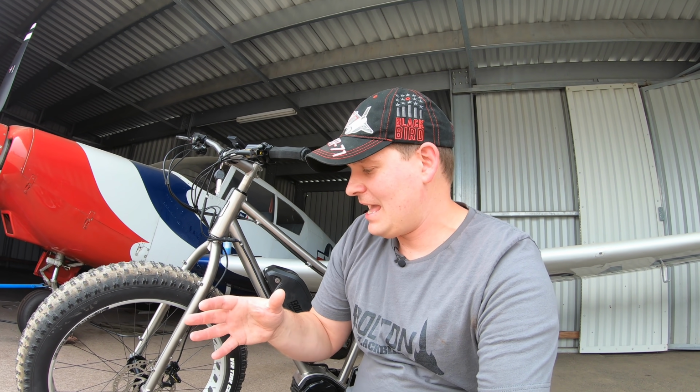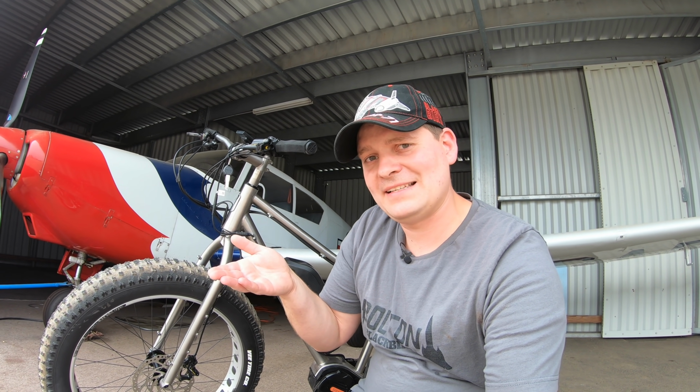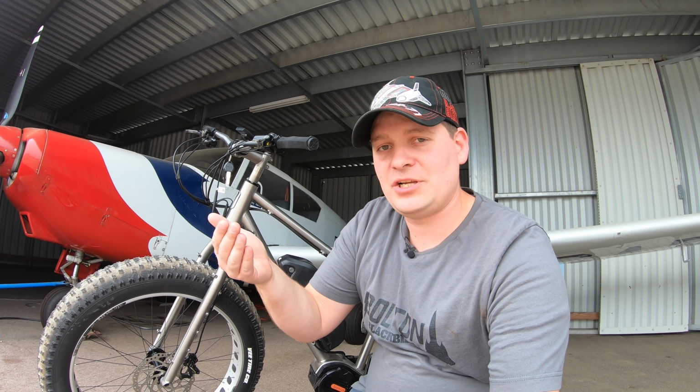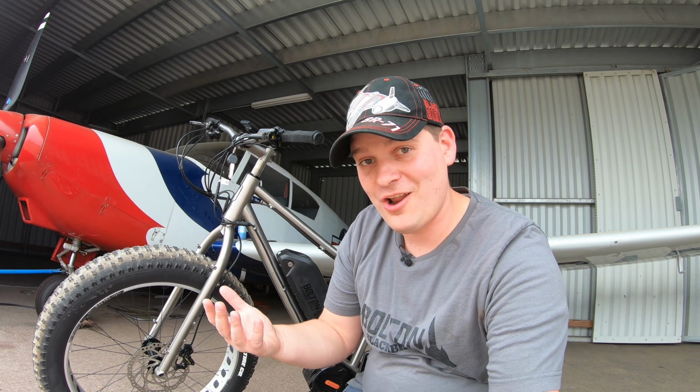And I do have some personal experience with this. Although I've never lost a wheel while riding, I did come close. I was on a mountain biking team ride, and at one of the stopping points, waiting for everybody to gather up, a fellow rider looked at my wheel and said, hey, you want to make sure your quick release is pointed in an upward direction or back, depending on the fork and how it's designed, because if it's hanging straight down, like mine was, it could potentially be loose. As he said that, he flicked my quick release, and sure enough, it actually was loose on that downhill. So thankfully he was there and watching out for me. We quickly tightened it up and went on our way, but that could have been disastrous.